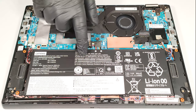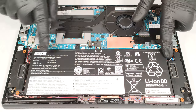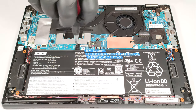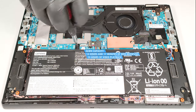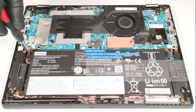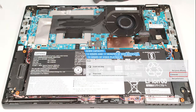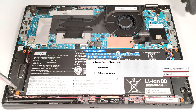The battery in this device is a 46-watt-hour model. To take it out, detach the connector from the motherboard and undo the four Phillips-head screws that keep the unit fixed to the base. The capacity is enough for 14 hours and 17 minutes of web browsing or 10 hours of videos. To achieve that, you have to apply the balanced preset in the Windows Power and Battery menu and set the scheme for battery to balanced mode in the BIOS.